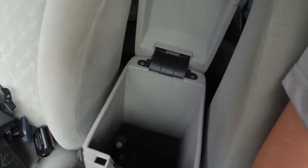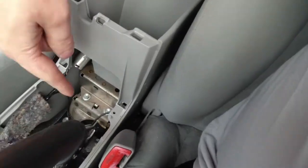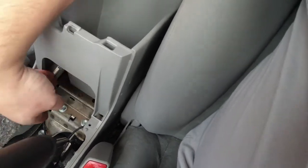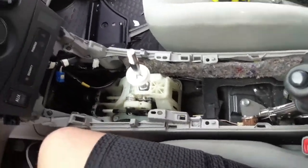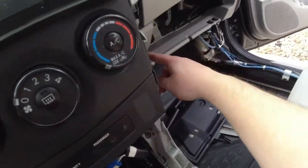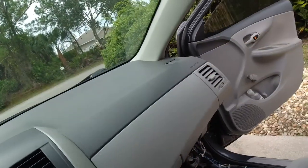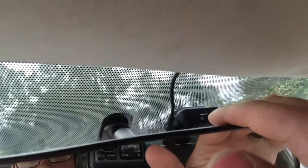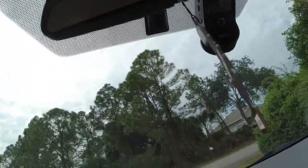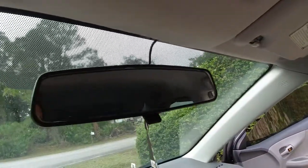Alright, just a quick update on where I'm at. I did get the cable ran in here. I dremeled out the hole a little bigger so I could run my cable through. I kept some slack and made sure nothing was going to rub. Then I ran it along the other wires, up into the A-pillar, and right up into the dash camera. I'm going to zip-tie that. Now I'll turn the car on to see how it works, and then we'll go do the back camera.